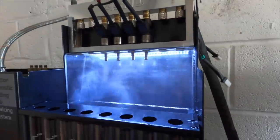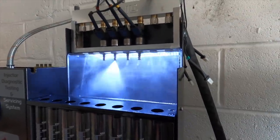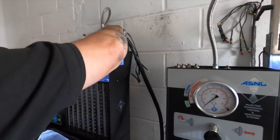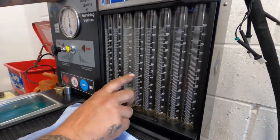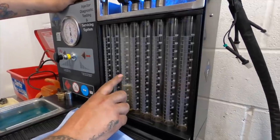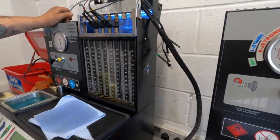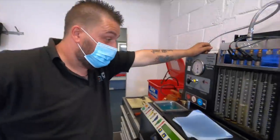So that's your cranking, this is how your injectors crank at different duty cycles. So 4 is the one that's causing the misfire. 4, maybe 3 as well. On K04 injectors, you should be about the 65 mark on all of them. Between 65 and 70, you can get, but ideally within that sort of range that we're looking for. Deja vu from the grey GTI video, as you guys might remember, about a year ago now.